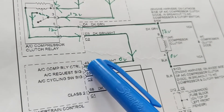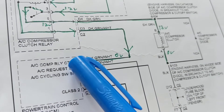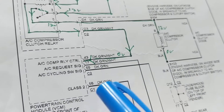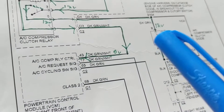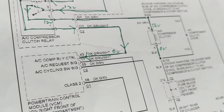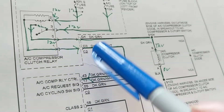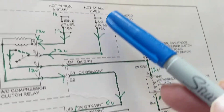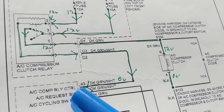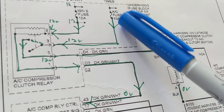So you'll get zero volts on the other side if the PCM gives the proper command for a ground. When you see the word 'control,' that tells you right away a command is being given to something else — it's having the power of activating this relay. Once that happens, we go to the other side. Notice it's only a 10-amp fuse — not too much — because you're going through the module and not pulling much current.